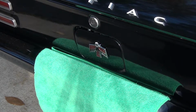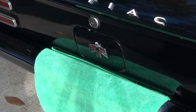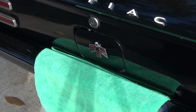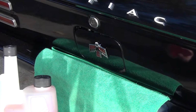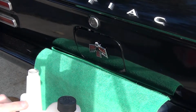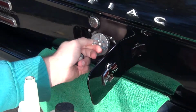To make sure that the chemical gets through your entire fuel system, you want to have your car running for a little bit. The instructions say that 1 ounce treats up to 2.5 gallons. I have a 12-gallon tank, so for 12.5 gallons, I'll need 5 ounces. So what you'll do is take this top off, squeeze this, do it 5 times, and then pour it into your gas tank.